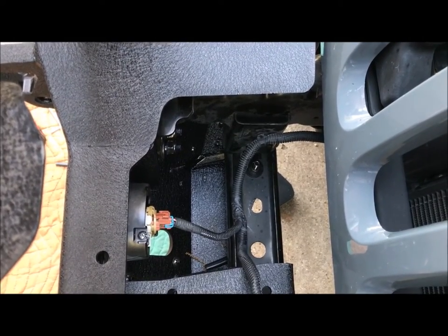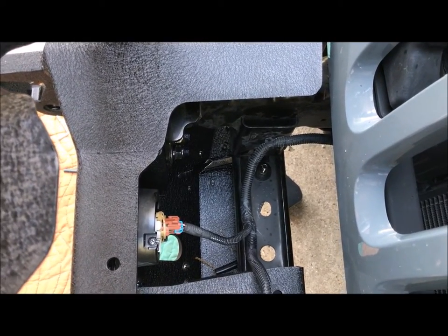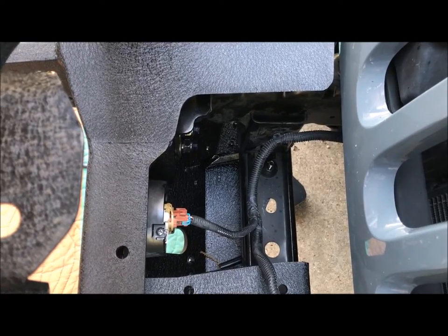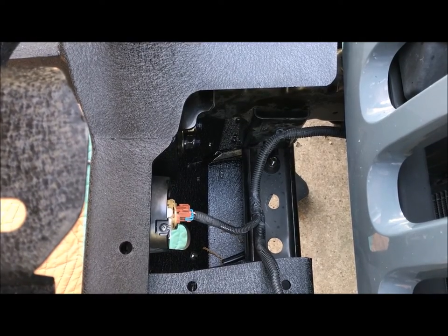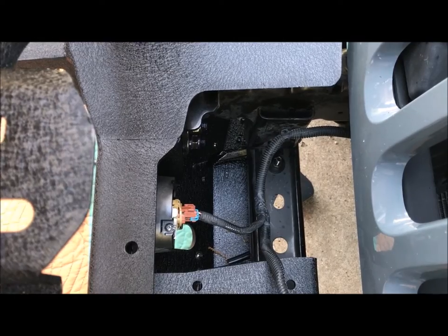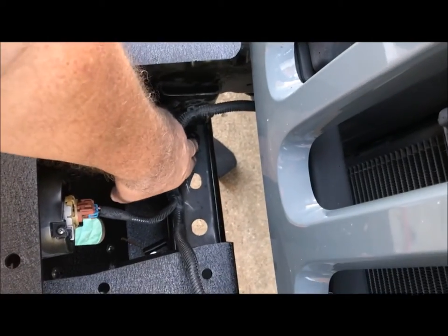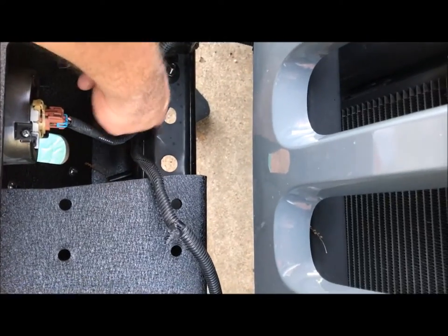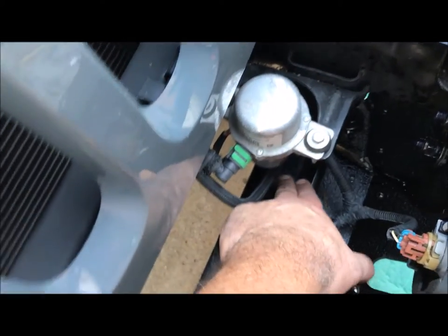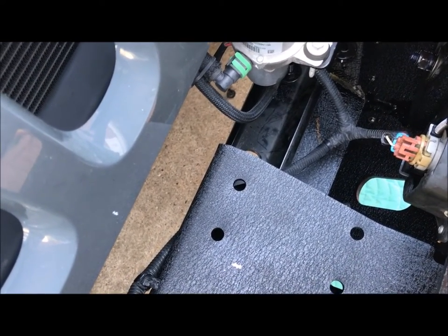You're gonna do this while leaving the actual front bumper loose. The problem I have is only one hole lined up, so what I'll probably do is take it to a shop and see if me and a buddy can correct the problem. If not, maybe we'll put a little tack weld right there on each side just to make sure there are no issues. Right down here are bolts that come up through the bottom where the bumper bolts to the frame - there's one on each side, and right underneath here is where you bolt it to the frame.